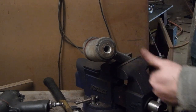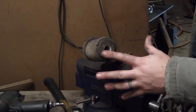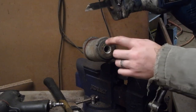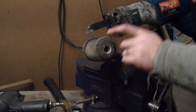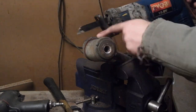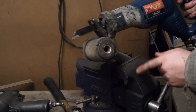I'll put a link up here to where I did these on the car with the W123 bushings, but this is easier. What I like to do is go ahead and just cut the bushing in half on both sides. What that allows me to do is then just press the whole thing off — two cuts with the Sawzall, a reciprocating saw, and we're in good shape.